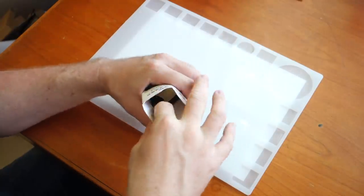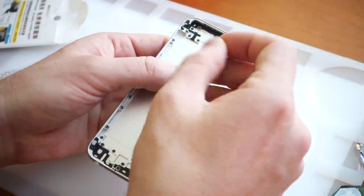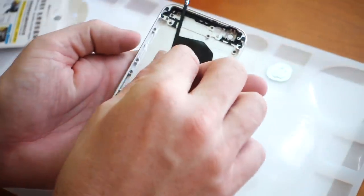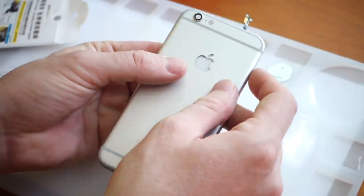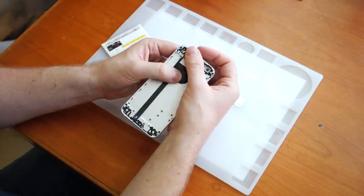It's a little flex PCB. Here's the logo part. This part up here has a few connectors that solder onto the backlight where it gets power. So what you do is take out this silver insert here, and this part just fits right into the back of here, right into that logo hole. And then this part up here solders onto the backlight for the LCD, and that's where it gets its power. So whenever the screen is on, the logo lights up.